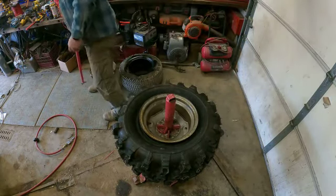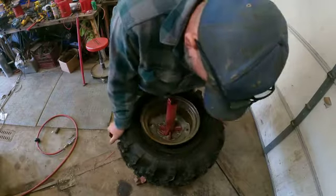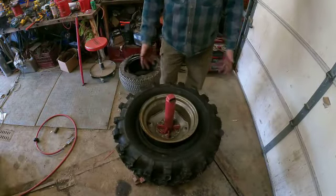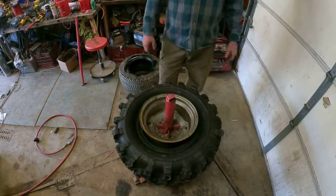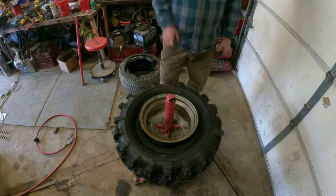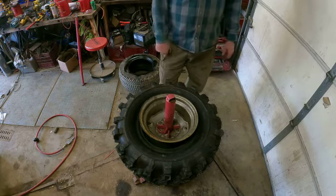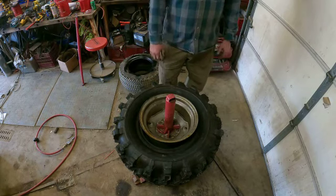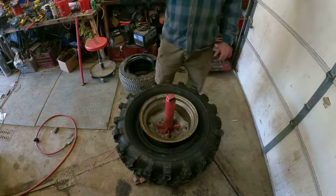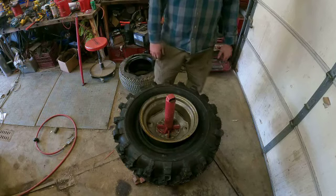Now you can see these rims are a little bit wide. I'm going to have a hell of a time getting a bead on this and I don't have a bead blaster. Sometimes you can get part of that bead locked. But what I'm going to end up having to do is put a strap around this - I'm assuming everybody knows that, but maybe you don't, we can go over that. Anyway, that's how I do it. So I'm going to take this one off, bust down the other tire, and get the other tire jammed on. I've already let the air out of it but I haven't broke the bead yet - so let's see how long it takes me to break the bead, throw it on here, lock it on here, break one down and get another tire put back on. We'll just see how long it takes.